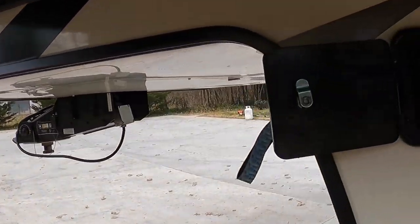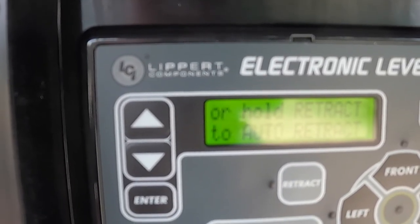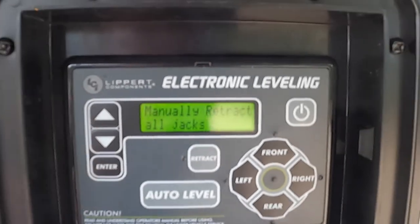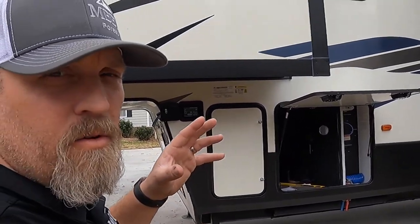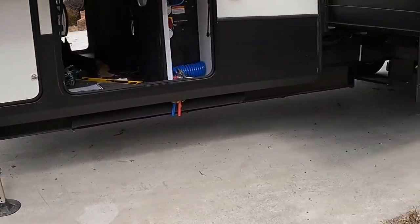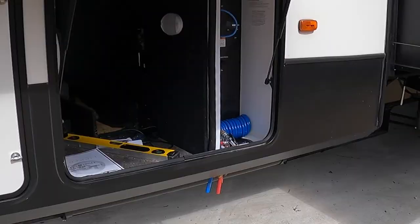The main issue I'm having is when I turn this on I'm getting a left front jack error. It says 'Retract everything.' When you retract all your jacks you're retracting them to the homing position — they call that 'homing' in the owner's manual. When I have all my jacks down I get the left front jack error. When I pull everything up to the homing position I get a right middle error — that's the jack on the other side that will not move.